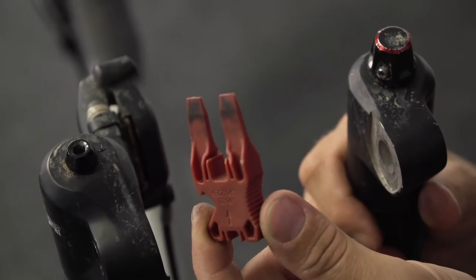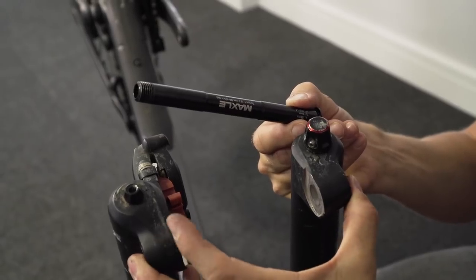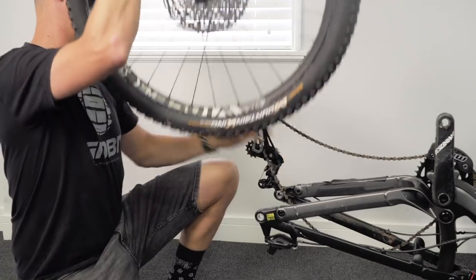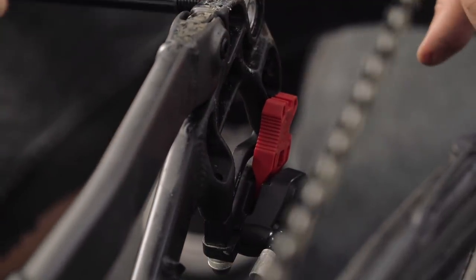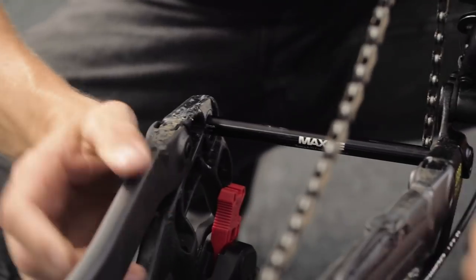Make sure your pad spacers are clean. When you put your axle back into the fork or into the frame, I'd only recommend putting it in loosely. If you tighten it up you're actually going to pull everything together — you don't want that — so it still has free movement if it accidentally gets squashed. It also means you know where your axle is because it's part of the frame and part of the fork, so it's not going to wander around your bike bag and scratch anything. I'm just repeating the same process for the back end — backing out that axle, removing it from the bike, placing the pad spacer between the rear brake pads, and replacing the axle loosely so the frame can move if it needs to.